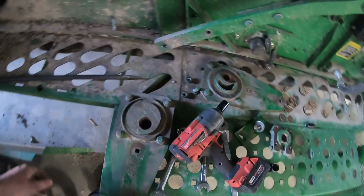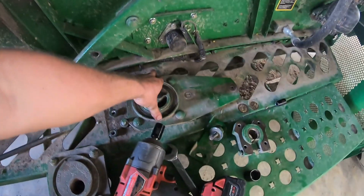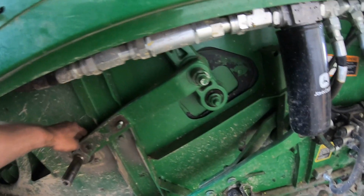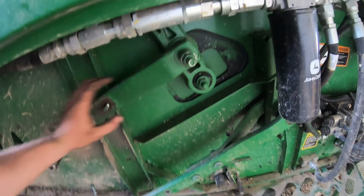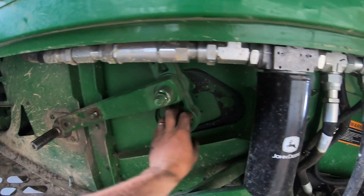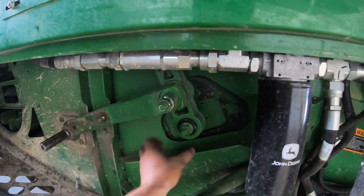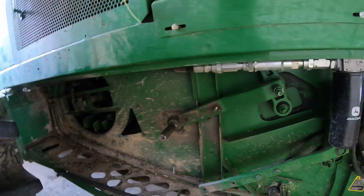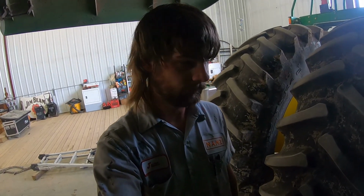I got to take all this apart because these wasn't straight in the holders. And then when you put it back together, you got to rotate it so that this cams back into the center of this hole, so that these rubber bushings ain't stretched one way. No, it's a complicated mess. It's hard to do. Easy to pinch your fingers. I've obviously got covered in grease. It's been good fun. But we'll get her back together, I guess.